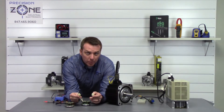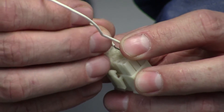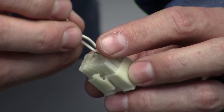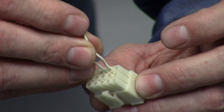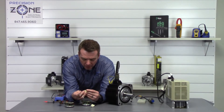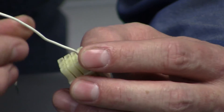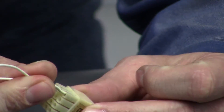The 12-pin and 15-pin connectors are really common as well. On the 15-pin connector, you're going to be shorting pins 13 and 14 together for at least two minutes. For the 12-pin connector, you'll be shorting pins 9 and 12 together, again for a full two minutes.